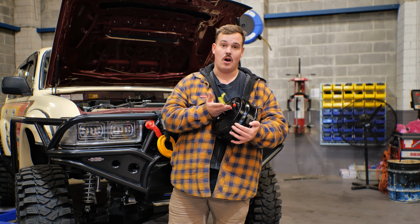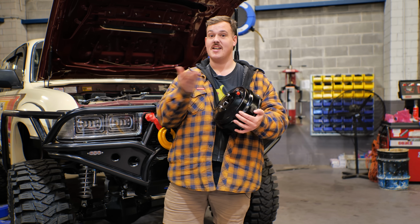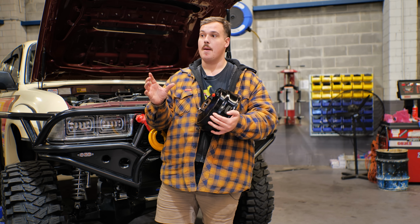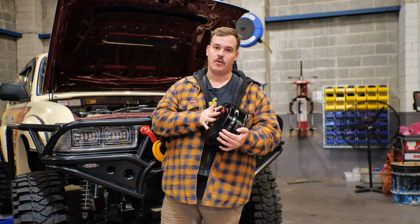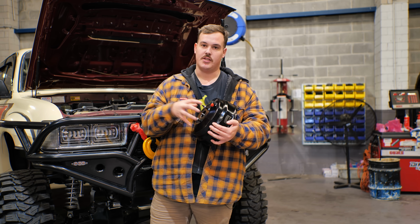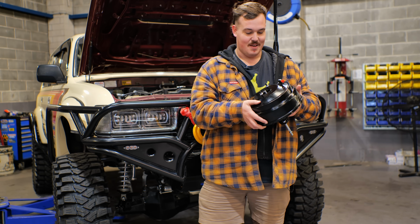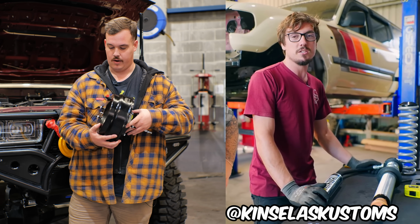This guy, dual diaphragm, so you can probably guess the science that's going on in here. There's two of them, which means basically twice the braking pressure that's going to be able to be applied through the pedal, given the same exertion of effort. So you're basically just going to have a massive improvement in braking performance and braking pressure from installing this. It's not even that much bigger. It's around 10 to 15 mil deeper than the factory unit, which is important for us because someone put a coilover tower right in the way, and that's kind of annoying.